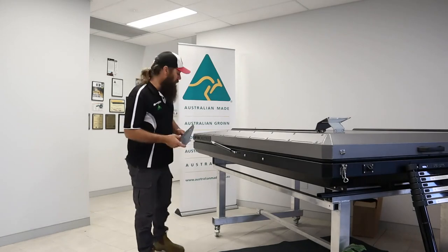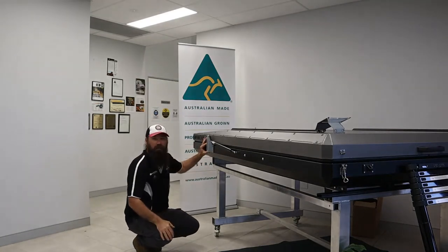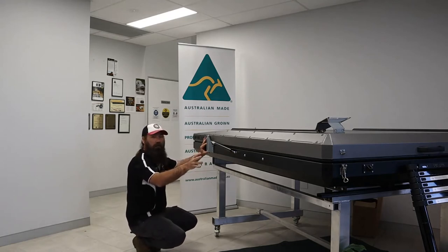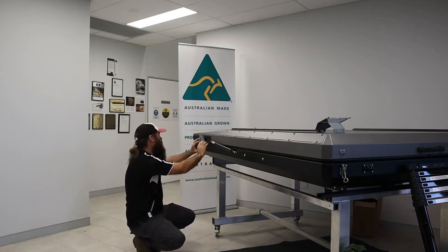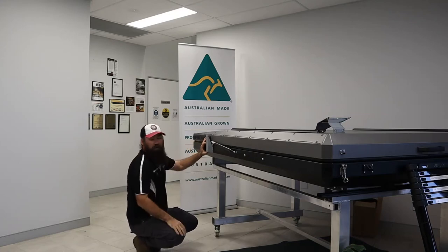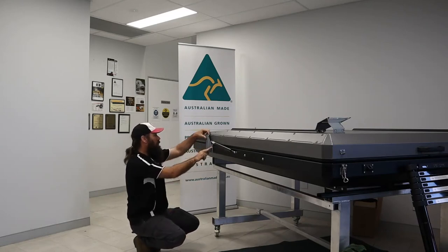So you're not going to have an issue with that. But you've got to make sure that when you're mounted, you're mounted with clearance at the front for your gas strut. That's why we mark them out when they're closed — you can mount it anywhere along the front, that doesn't matter. Just got to make sure you're not going to interfere with your gas strut when you mount that front bridging awning. Pretty simple, same as the rear.